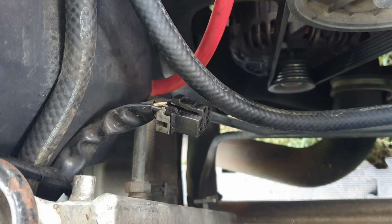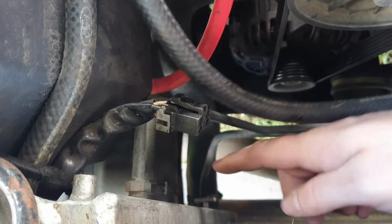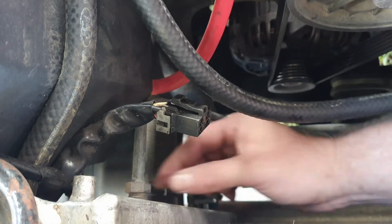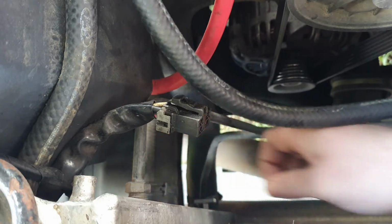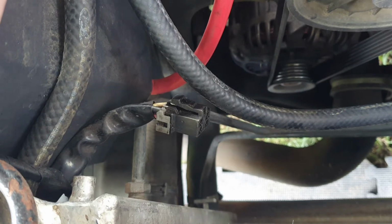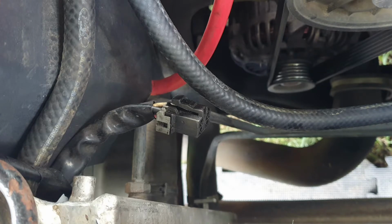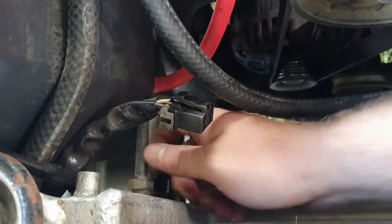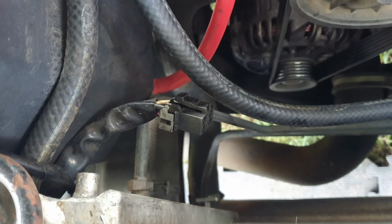Alright, so I've just pulled out all that, so I've brought you down here. Sorry about the dogs. What we're going to be disconnecting is this hose here and this one just down here. Then we're going to pull these off, grind the end of these off, and then I have an attachment that connects to them, that then connects to the pipe. And then no more cooling through the radiator, so no more milkshakes, no more problems, and we get a bigger transcooler, so protect the gearbox. So next thing I'm going to do is find something to undo these two bolts. We'll pull these out and probably empty that out, or maybe block it off with a bolt, and then from there we'll just go on and I'll show you how to connect it all up.